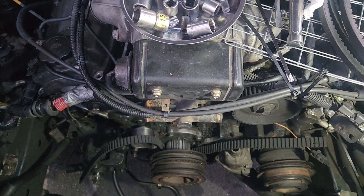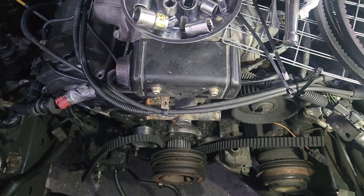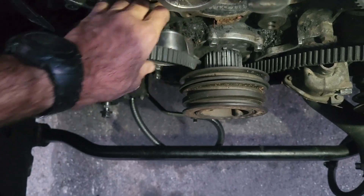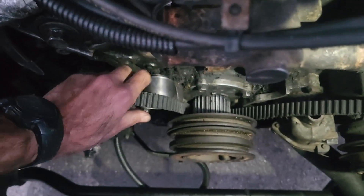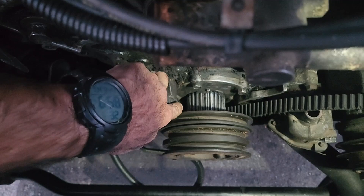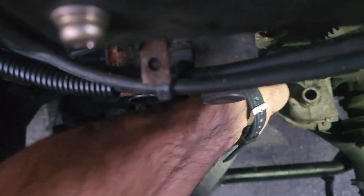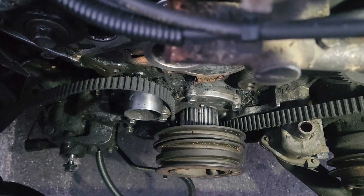What I've concluded is that this is possible if you have the right configuration on your engine and the right tools and techniques. The reason it wasn't possible on my engine — the reason I was only able to turn it half a revolution before it started skipping teeth — is because my crankshaft has a very small tight clearance on the bottom. So once the zip tie gets underneath there it starts binding up, and that's when it starts skipping teeth. If you're lucky and your crankshaft has a bigger clearance, then this definitely could be possible.